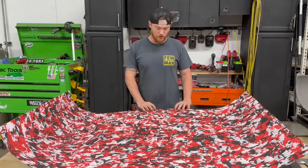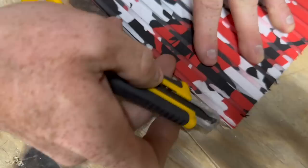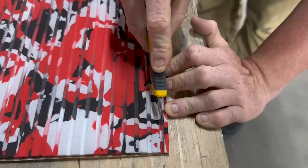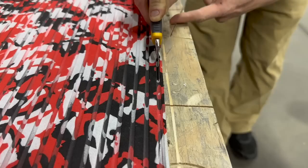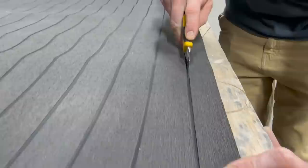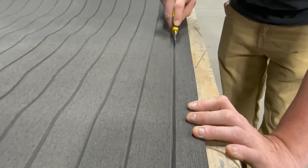Now let's talk about the long side of the sheet. These are square but they may not look or lay square — sometimes the cut is not exactly even with the grooves on both sides. So the first thing you need to do once you pull these out of the box is make your first cut on an identical line. With the HydroTurf cut groove option, cut at the very lowest point in the groove — this prevents your foot from catching the edge after installation. Same with the two-inch teak cut: cut right in the middle of the lowest router line.